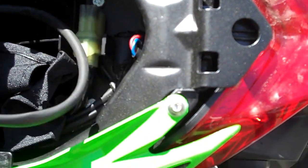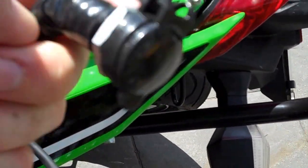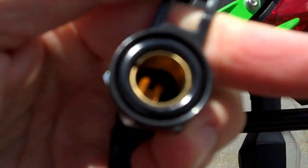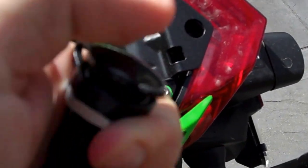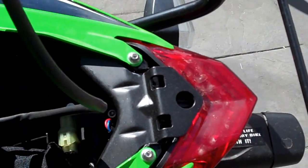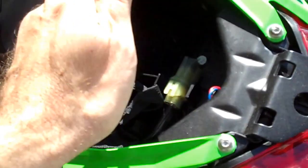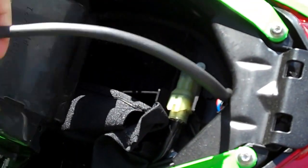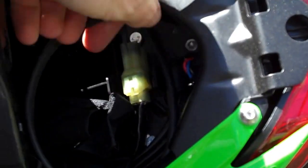This is actually the power cable here. It's got a decent enough cord on it. It's actually a proper little waterproof BMW power socket. Now, we use a standard BMW one because they are actually designed for high current applications. Cigarette lighters are not designed for high current applications — no matter what anybody tries to tell you, they're not designed for it. I've lost count the number of times over the years where I've seen standard power sockets get melted because of the amperage they're trying to pump through them.